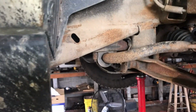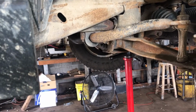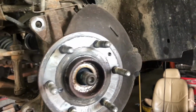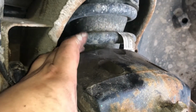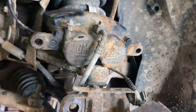First thing you want to take off looks like this. That is a T30. Took that off, and we got our brakes. We got 19 millimeter on both ears of the caliper. Fit a screwdriver in this peek hole and kind of press the piston back. Be careful if you're reusing your brakes and rotor.